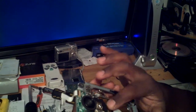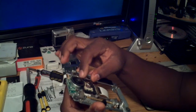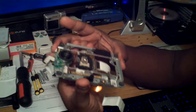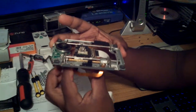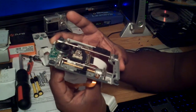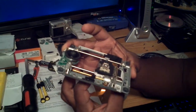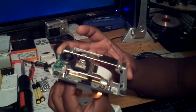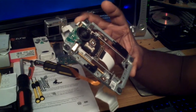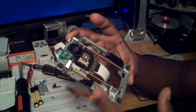It's not the actual Blu-ray lens that goes bad — the lens is fine. It's the motor that makes the lens go back and forth to read information on the disc throughout the layers. If this motor burns out, your optical lens will be pushed all the way forward or all the way back and won't move at all. So when people think their whole Blu-ray drive or optical lens is bad, it's actually the motor.